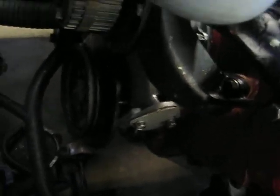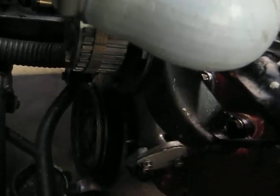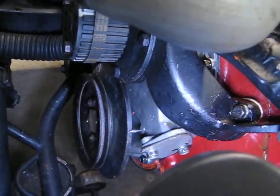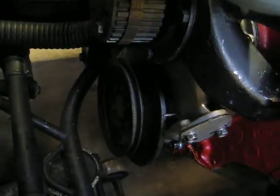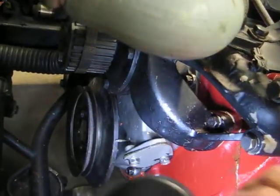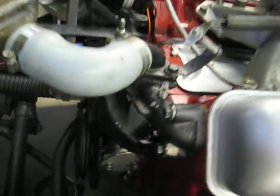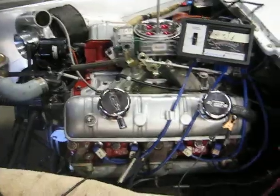Our damper down here is hard to see, but I use the old-style flat-type damper. I have it marked with chalk on the side because there are no reference points other than that pointer you see there. The pointer will be at top dead center when everything's at zero.